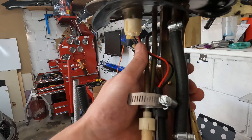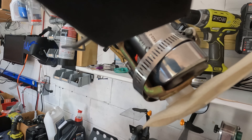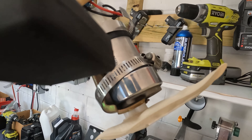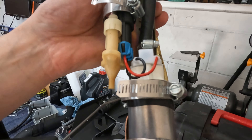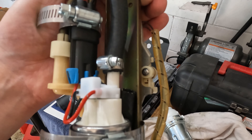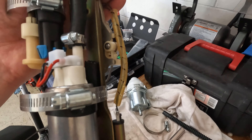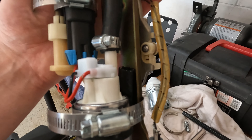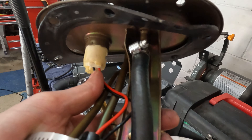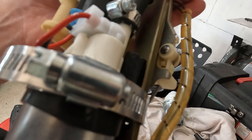I'm not afraid to show off my creative work — it's not the best, but here we go. So on the fuel hanger, I couldn't get anything to adhere on the bottom rubber, so I tried to keep it elevated to keep things separated. This first clamp isn't really doing much — it's just holding it in place. The top clamp is the one actually holding it on. I have a rubber piece around it and a hose stuffed down in there. I don't want it fully clamped down — from what I've read, you want it to be able to assume its vibration when it pumps. There's some rubber there to help with that, and the hose goes right up into the pump. The wiring is held in place with a smaller clamp.